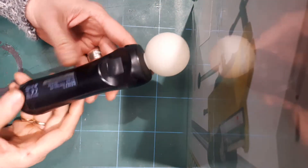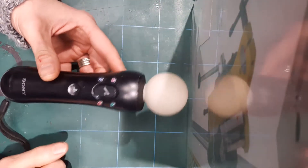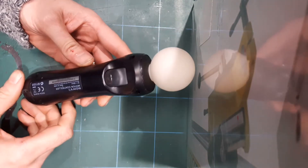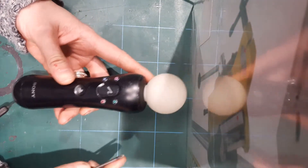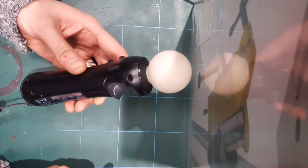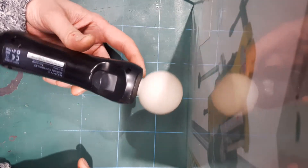So the PlayStation VR — I dug out the old motion controllers for my PS3 and the batteries are pretty much dead to be honest. I've seen replacement batteries on eBay, but the real big drawback is there's only 1300 milliamp hours. I thought there must be a bigger battery out there that you can fit, and it turns out there is. This is a quick video to show you how to swap the batteries over.